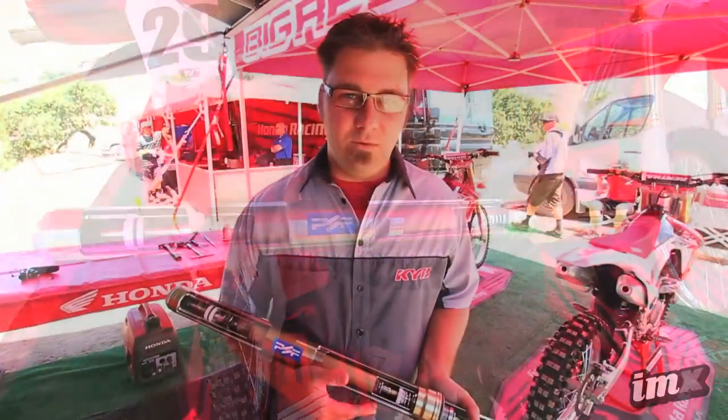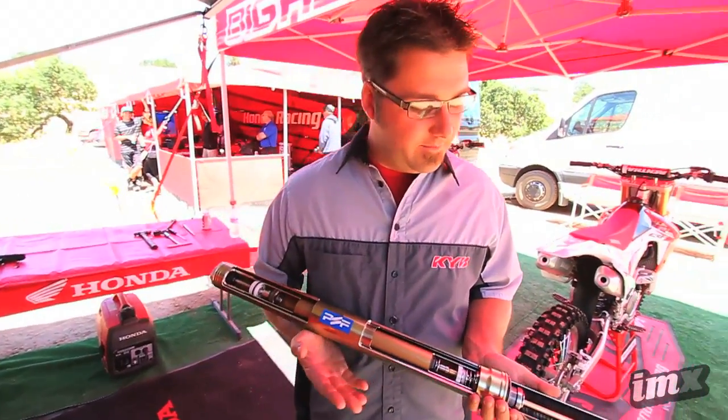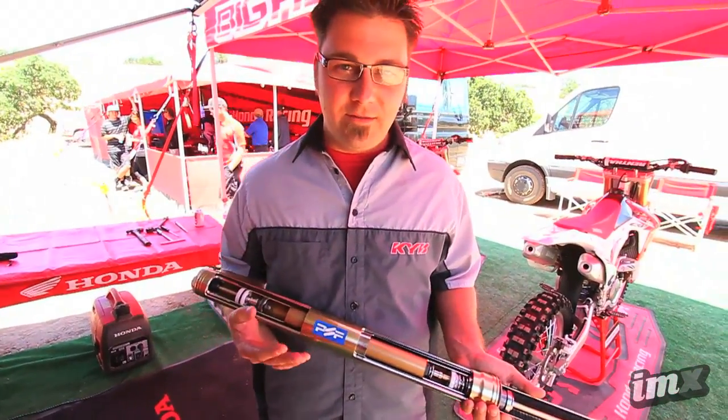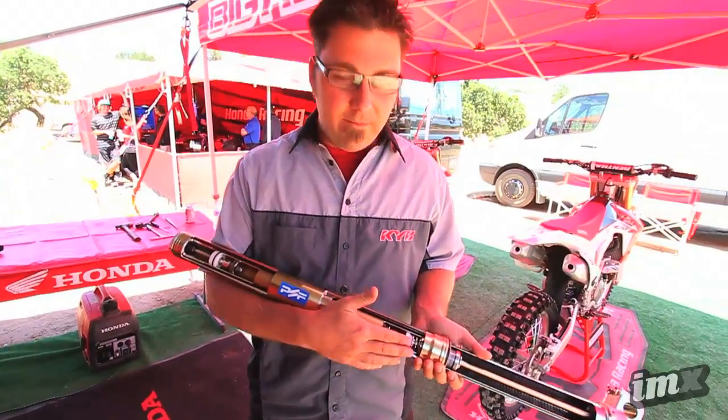I don't have the full details so I'll hand it over to someone who does. Hi, I'm Dan Worley from KYB. I'm here to introduce our new PSF fork. As you've heard, we've removed the main spring and also the pressure spring. Everything — the cartridge is charged and the main spring function is all done by air. We do have a balance spring to help keep it a linear character.